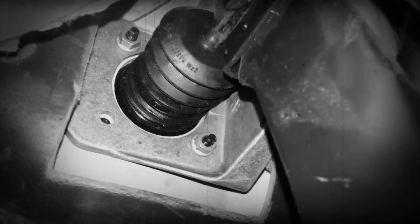The vacuum brake booster found in many popular European vehicles is known for plunger seal failure, which creates a hissing noise behind the steering column. This seal is prone to wear and cracking. Air leaking past the plunger seal creates the whistling sound and reduces power brake assistance.